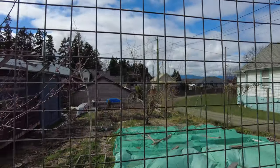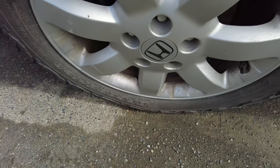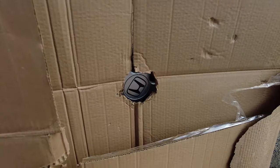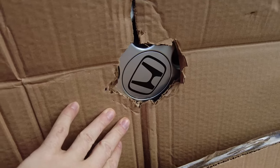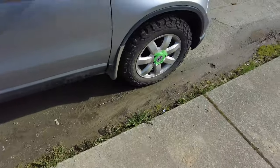I'm going to use that same blue on the Honda symbols here so it ties the vehicle together. I think I can just stick paper in there and spray it. I figured out a solution — I took a piece of cardboard, cut a hole in it roughly the size of the emblem, and I'll use painter's tape around it and then just blast it. I'm trying to avoid at all costs taking off the emblem — it looks like you'd have to take the wheels off and pop it out from the back. This is going to be easy. I just need to make sure it's not gusting wind. I've got all four tires taped up. I tried putting normal paper over top and cutting a perfect circle with an exacto knife but it just wasn't clean enough — there would be overspray.